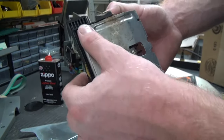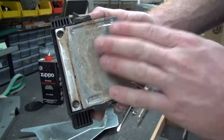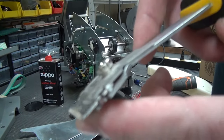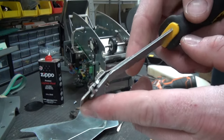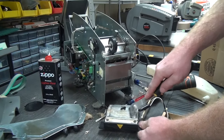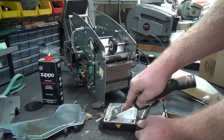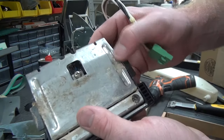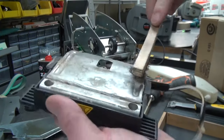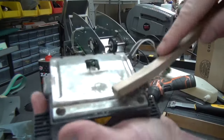One of the most important places to clean is on the underside of this heater. All this buildup all through here can create a lip where tape can catch and cause a jam. I like to use our window scraper here — if you hadn't noticed, this is a bit of a thicker blade in the window scraper, not just a regular razor blade; you can find these at Home Depot. Scrape it down. In these little crease areas on the left and right I like to use a wire brush to clean that out as opposed to scraping — you'll just wind up hurting yourself. Clean through this crease too.